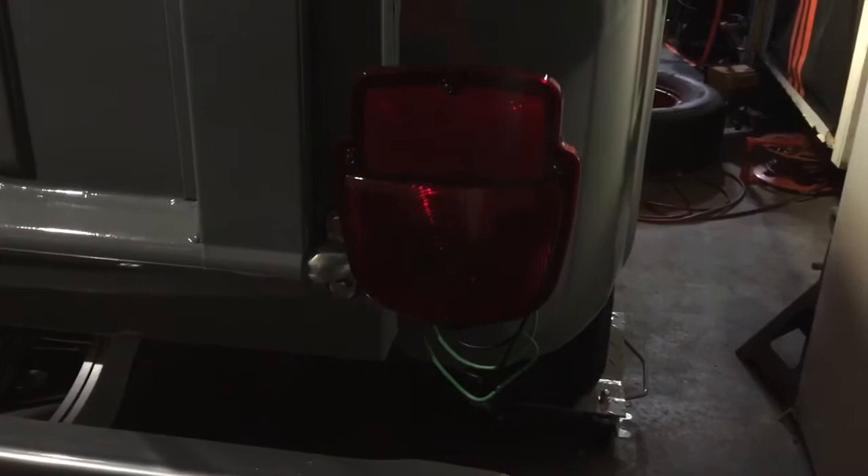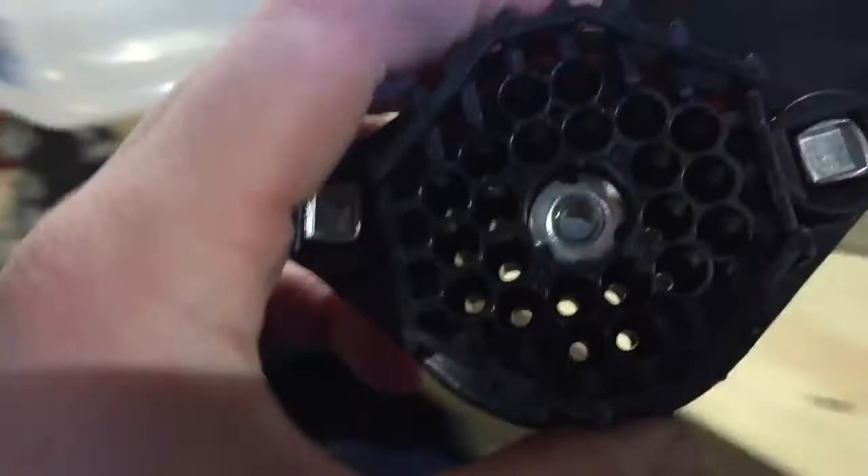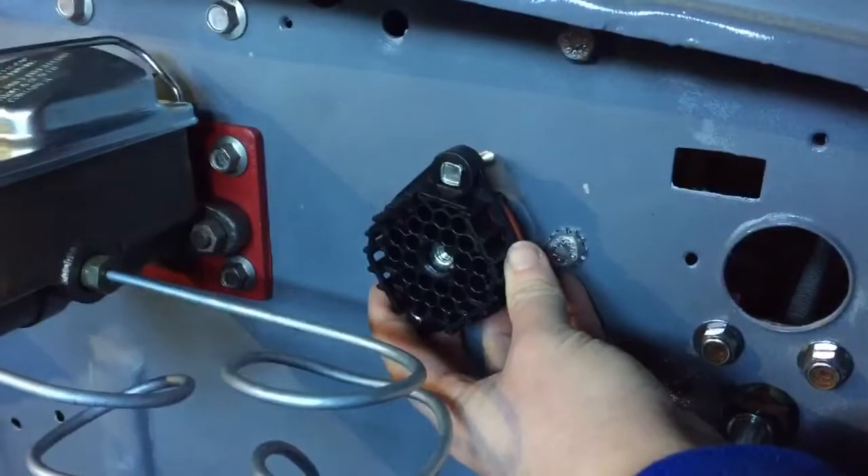There's no white light, so that's why I got those round ones and I'm going to put them somewhere under here. There's actually a hole here inside the bumper and I thought about maybe putting the light right here, kind of hanging down low so that you can still see it without it being overwhelming. This is the Weatherpack 22-pin plug that I bought off Amazon. I couldn't quite tell if it was going to be too big or not for the one punch-out hole that is already available — see that one there is where the original wire harness came out. This is just slightly too big. There is another punch-out here that I thought about pushing through and mounting there.